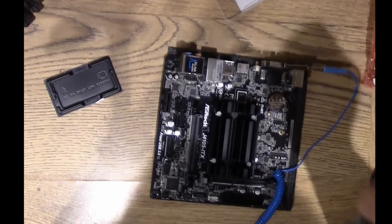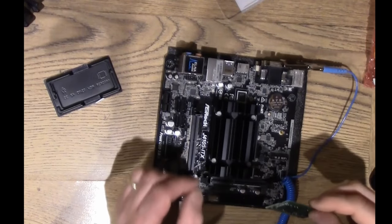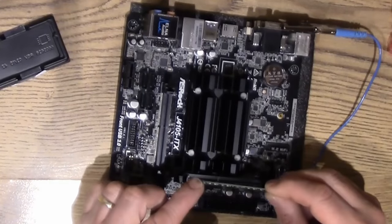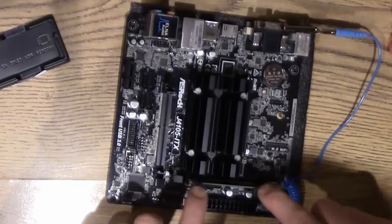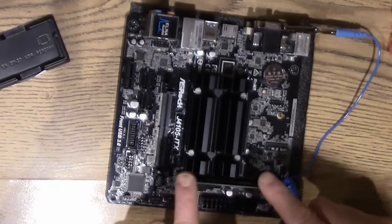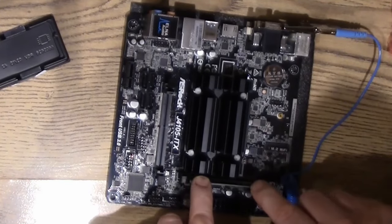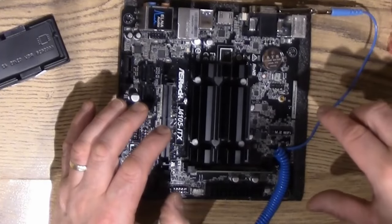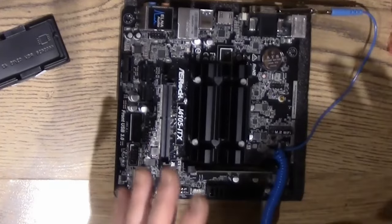Remember how easy I said this would be — plug and play? The RAM has a slit that's offset so you can't put it in the wrong way. Line the slit up with the spade on the DIMM slot and slide it down in a downward motion. Push it down until the two side clips lift up and lock it into position — you'll hear a click. Push from one side at a time and maneuver it into place. Once the two clips have come up and locked, the RAM is installed. Combined with the embedded CPU and heatsink, this is essentially your complete PC — it just needs a hard drive and cables.